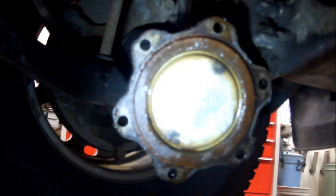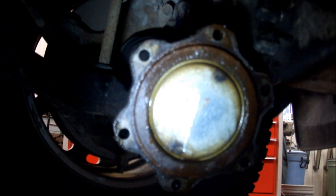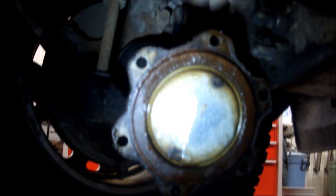We're underneath the 2500 Silverado here to show you what all has to come off. On the passenger side you have to take the flange off — there are six bolts that hold it to the differential output shaft. On the other side it's the same type of flange, six bolts, take them loose. You also have to take off your drive shaft from the differential on the input and just slide that back out of the way.